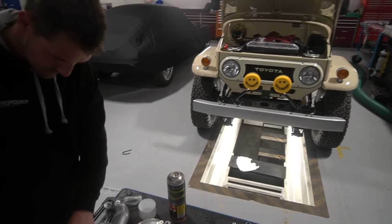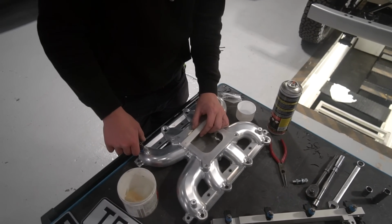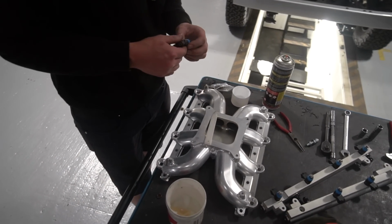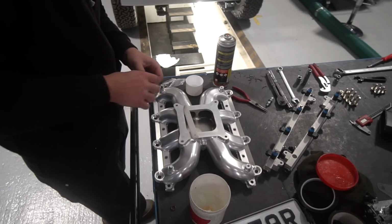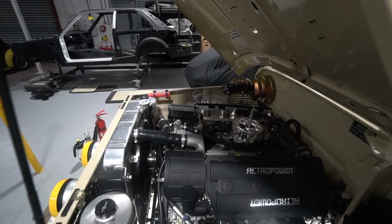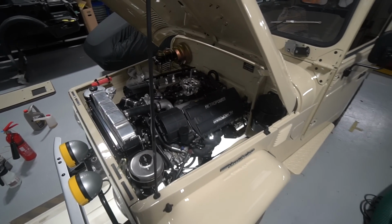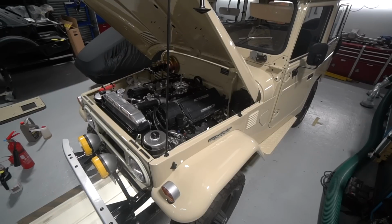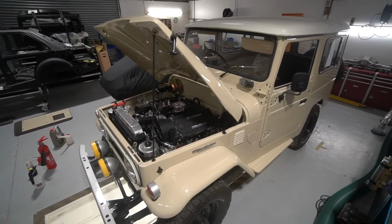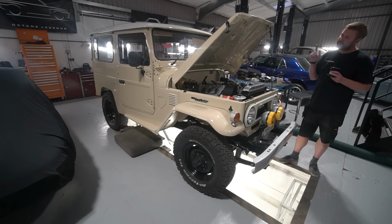So there was a small air leak on an injector, but fixing it didn't solve the squeak problem. So then we had to put our heads back into the game and think, what on earth could it be? We thought, well, go back to the cams. We'd already looked at the cams, checked all the cam caps, made sure there was oil feed there, made sure the condition of them looked fine, and that all looked great. But we went back to it again and thought, well, could it be the shims?